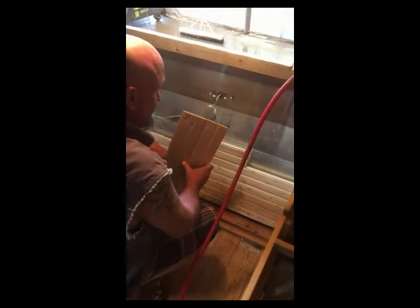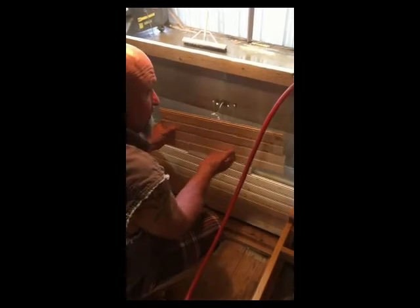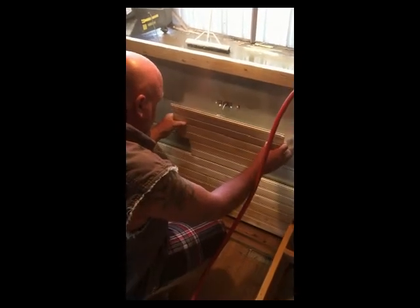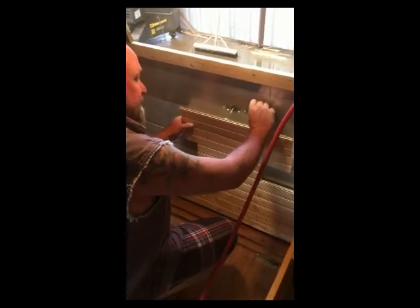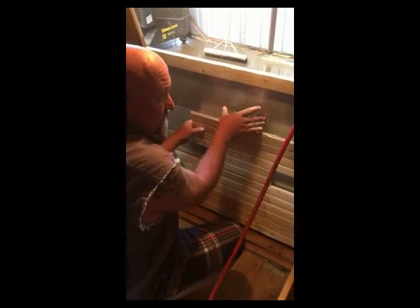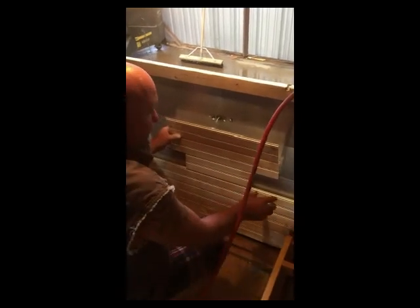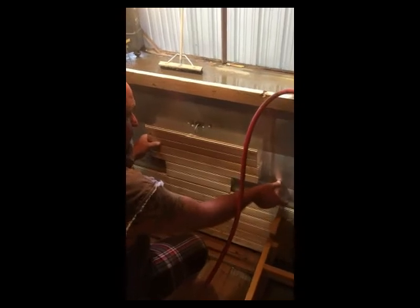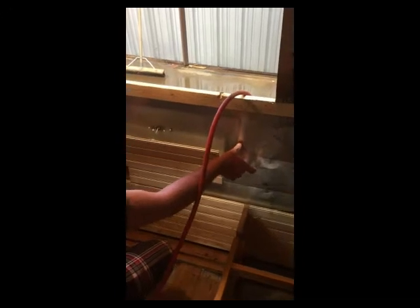Okay, so are we going to do a long one next? Explain what you're doing. Right now I'm trying to figure out where I need the longest support. I need a long support right here so I can attach plywood where the license plate goes and where the tail lights attach. You want the most support there. They vibrate, and metal fatigue will make them fall off. So we're going to run small supports here, a long support here, small supports here, and another long one here. On the creases. To give it the most support. That makes sense.